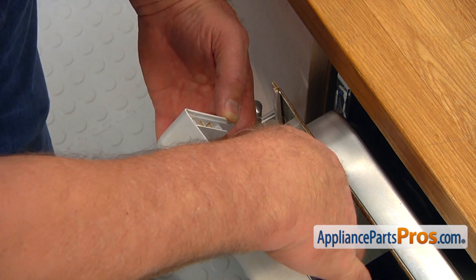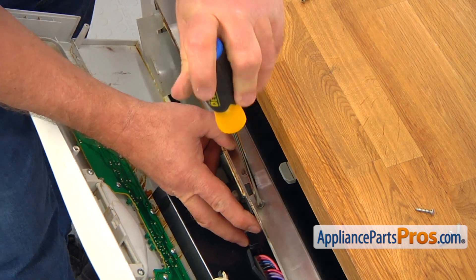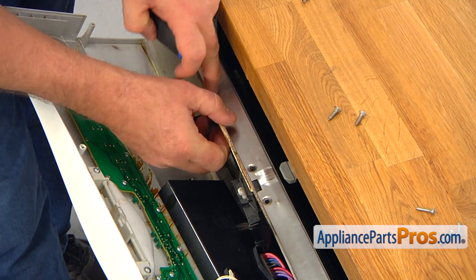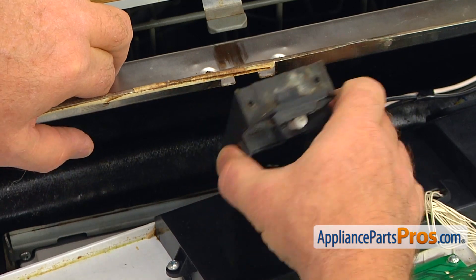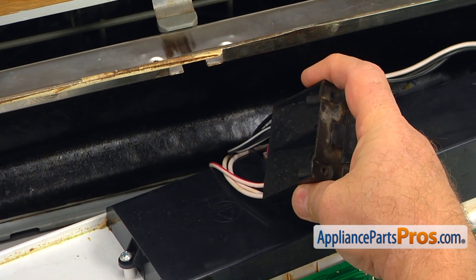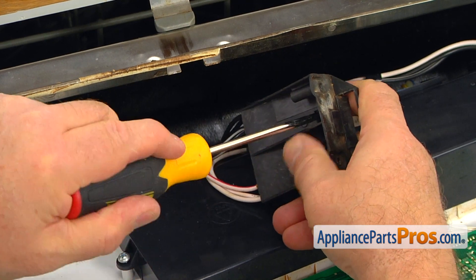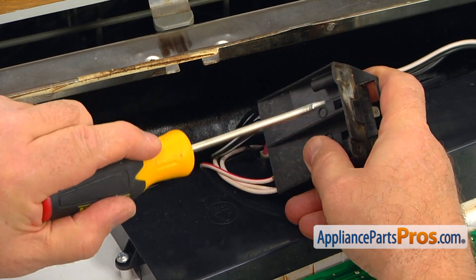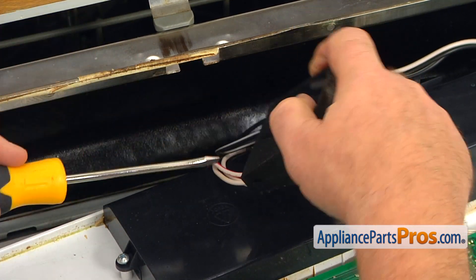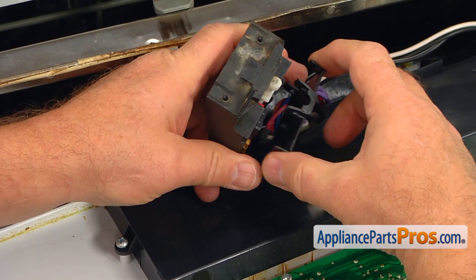You need to go on the side from this plastic casing. And then we're going to take out these two Phillips screws on the top that hold the door switch. I'm going to pull it out and now we need to remove this cover. I'm going to use the flat blade screwdriver to open these tabs and pop them.